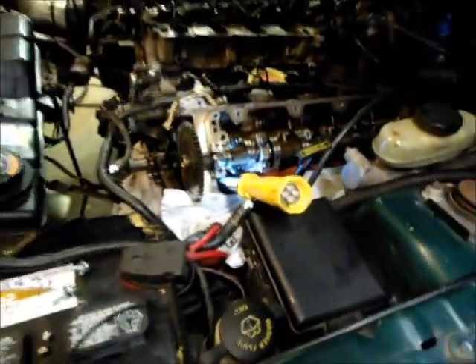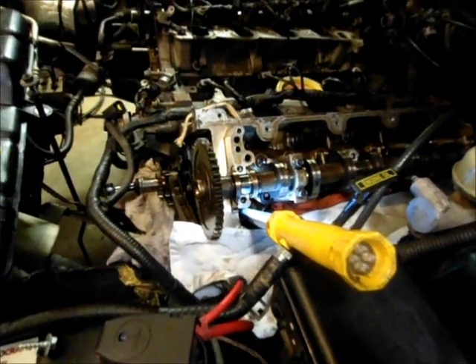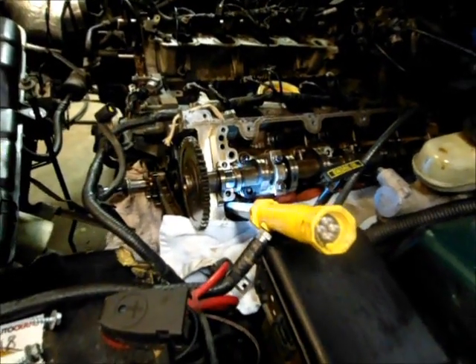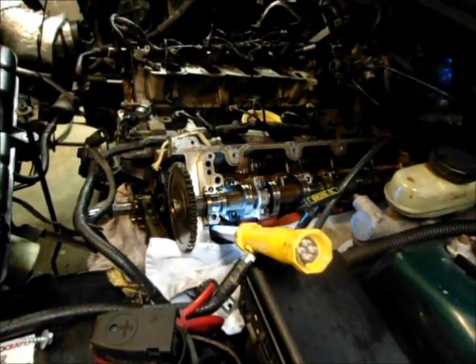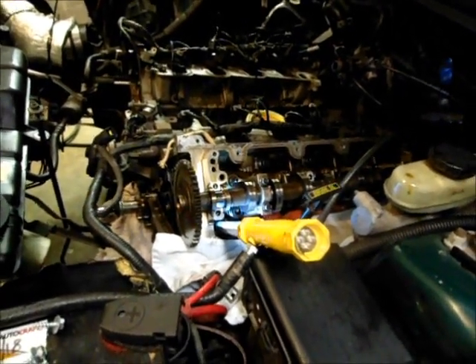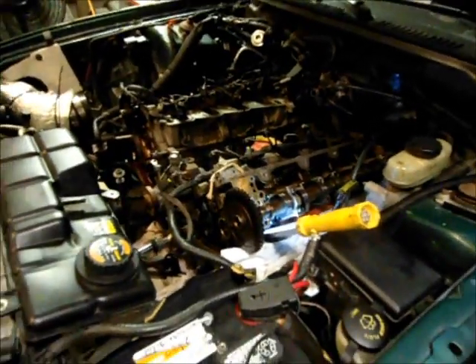Do it though — don't skimp on the springs. Everybody asks if the springs are really necessary. Yes, they are. I'll let a real mechanic or engineer tell you why, but this is an expensive upgrade. Why would you risk your entire motor as far as piston-to-valve clearance goes with the big duration cams and stock springs that just float above 4,000 RPMs? Get the better springs. Even if you weren't changing cams at a hundred thousand miles, if you change springs, you would probably notice a little bit of an improvement in your drivability. Okay folks, till the next time.